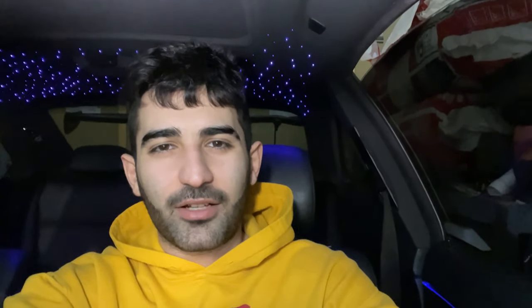When you look at the steering wheel on the clock spring setup, everything is identical to the non-M E46 models. The only difference is that you're missing a connection point that sits inside the clock spring and, on top of that, the paddle shifters that sit on the steering wheel. In today's video I'm going to completely show you guys how to get working paddle shifters in your non-SMG E46s — also known as the Steptronic automatics. Let's head straight into the install.